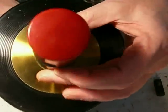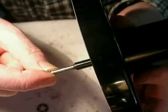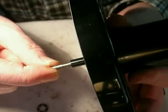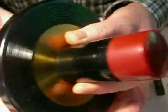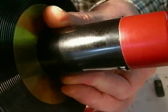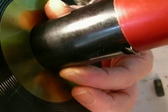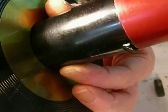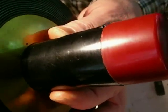Now it's time to take a look at it. When you cycle this through — before you put this back in the machine, be mindful — this is going to want to go up inside the red cap, so pull downwards on it as you turn it. Try it and see how it turns; look how smooth that is. Make sure the bottom shelf comes out as the top shelf and separator go out to hold the records up, and make sure it happens on both sides. Just as good as new.